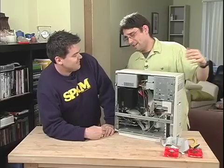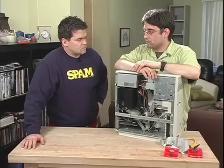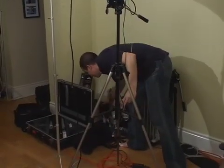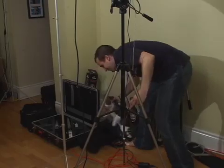So ideally what you want is airflow through this machine. If the air stagnates inside, it just gathers heat. All the components will get overheated, which will lead to premature failure of the components inside. So if you've got a hard drive and it's all mashed in against other hard drives, or you've got all your cards wedged in against each other with cables blocking the way — that's a problem.